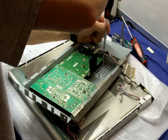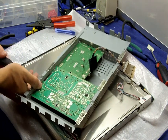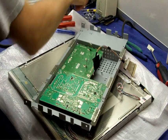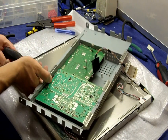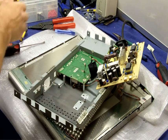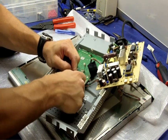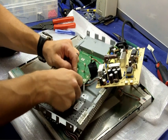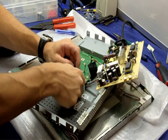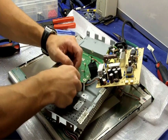On the board in the rear, I remove all the screws except for the one in the far back — the only reason I don't take it all the way out is because these two cards are attached by only one cable. I'm removing the screws that hold the power plug itself in. Then this card just picks right up. There's thermal compound on it so there's a good chance of making a mess. I'm taking a very small screwdriver and pushing out a rainbow cable — you can just work it right out of its plug, then slide it through where one of the screw posts are and pull the card we'll be working on free.